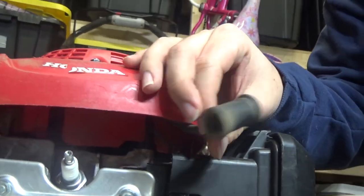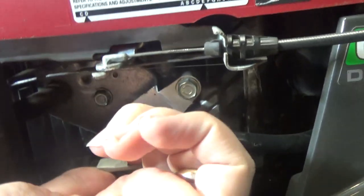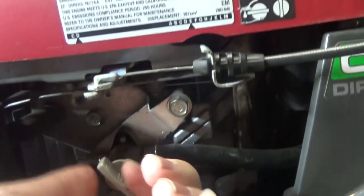So I'm gonna replace it. Obviously, unplug the spark plug whenever you're doing anything. Boom. It's just good safety. The next step is to flip this guy here. You don't want any gas leaks. Oops, that way. All right. It's pouring out, and I want to get this done. So this is the part where I would probably just run the engine until the gas that's left up in the line is used up, and then wait for it to cool before continuing. But I'm going to get a bunch of rags and hopefully not make too much of a mess.